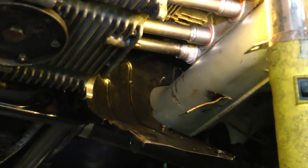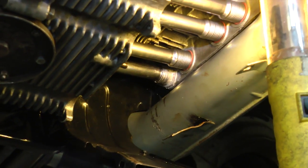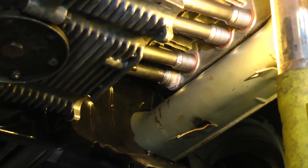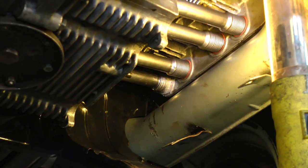We just put the Honda Bond on there, and this stuff has to cure for about a good 15-16 hours to really start to penetrate it and to really seal it. They tell you 60 minutes is probably hard to the touch, but full cure is about 15 to 16 hours.